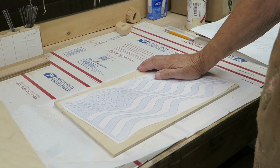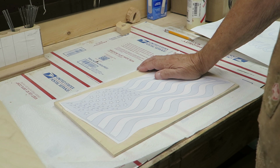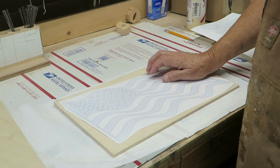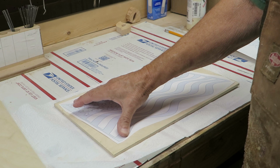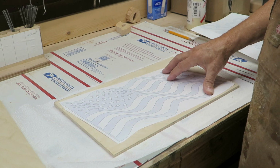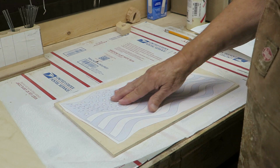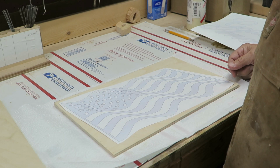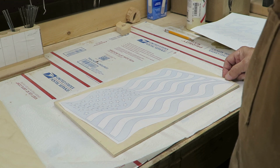Instead of putting in your paper like you normally do, you put this into the tray and it'll probably jut out about another inch or so beyond the tray. That's okay, just let it sit there, close it up. It's 8.5 inches wide, so it should be no problem with width. The length is going to be all banner-like. And you send it through the printer and you get yourself a nice printout and a larger size than you normally would on an 8.5 by 11 paper.